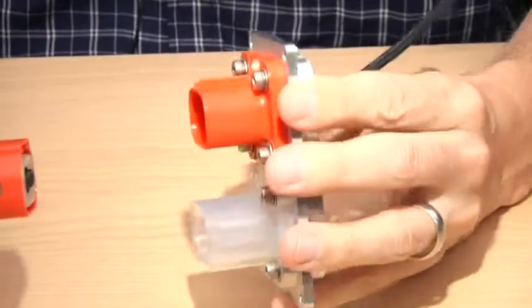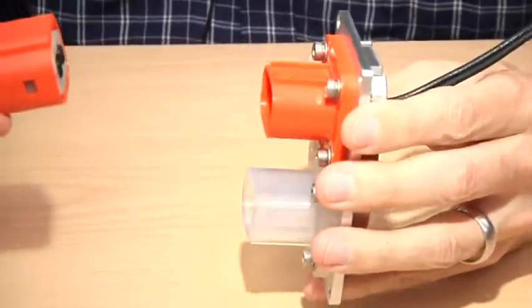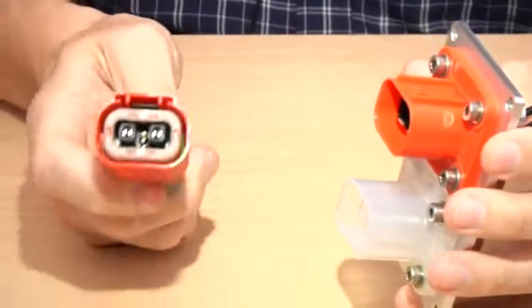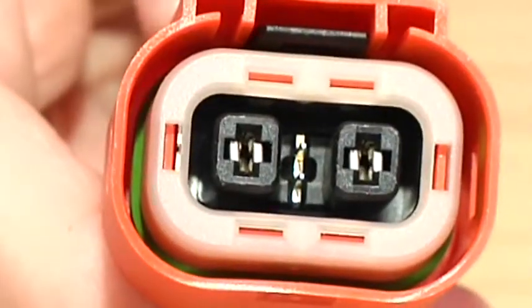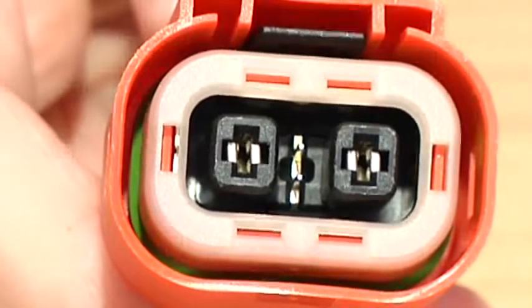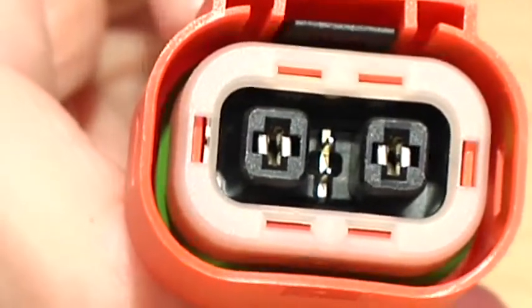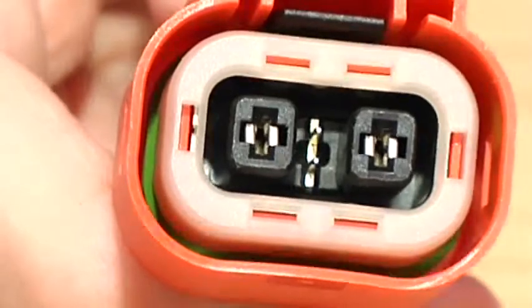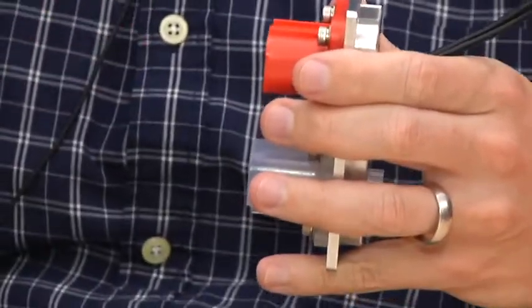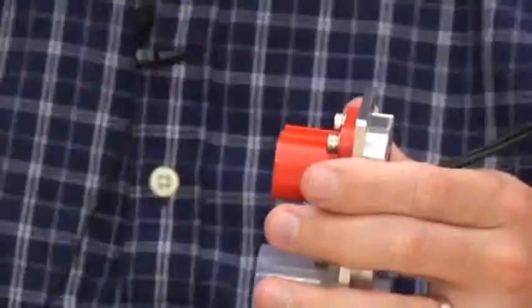In the next step with our HVA280 system, we took that high voltage interlock loop and moved it inside the connector. So now instead of having a piggyback connector, inside the connector there is a small shunt located between the high voltage conductors. We have that staged so that as you separate the two connectors, that high voltage shunt will separate first prior to the high voltage conductors separating.